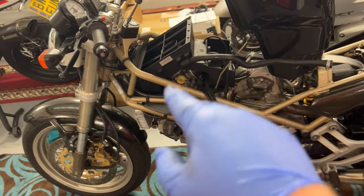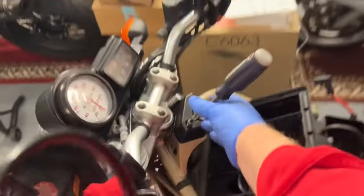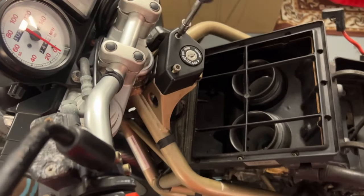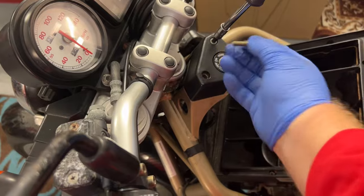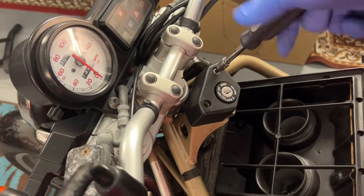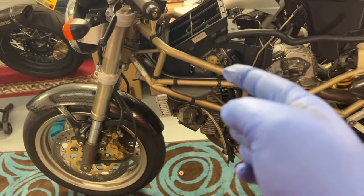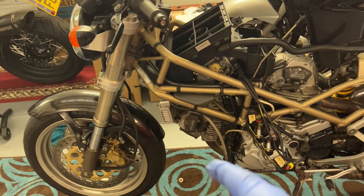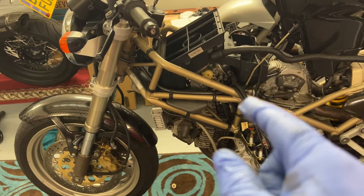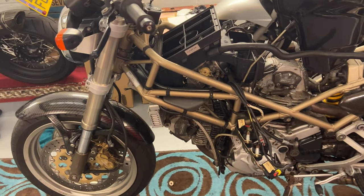It's just a disassembly to get to the carbs, it's so mahoosive. Take on the job, get to work on the job. Disassemble. Let's adjust the needles, pop it all back together, and have some kind of extension so that like any normal motorcycle we can adjust the tick over. Because otherwise that's just ridiculous.